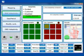Otherwise, this is not the case, because we have a mainly red region, but while red means lean mixture, yellow colors mean rich mixture. Okay, so this is a pre-mapping that the software calculates, checking the petrol and the gas samples. From this point now the ECU will continue to adapt itself, taking more and more gas samples while driving.